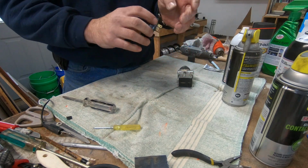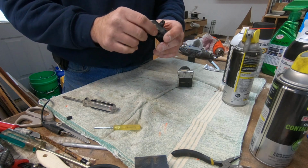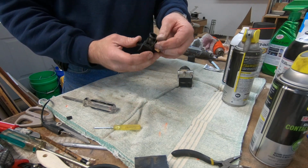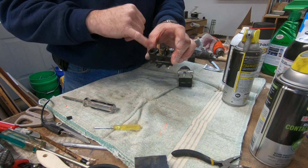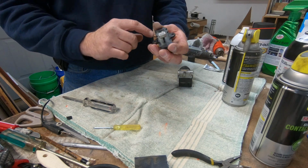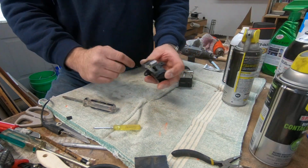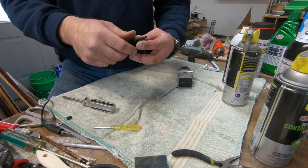What I'll do after this is dry it out and all the grease has settled down is come in here behind with some detail cleaner. I clean this up, check the leads on the back, make sure that they're clean. Clean them up if you need to. There's a light that goes in here, make sure that's good. Careful if you get too aggressive. This is already starting to turn white from the contact cleaner because it is kind of a solvent, and it'll whiten that up. But I'll put some vinyl dressing on there to bring the black back.